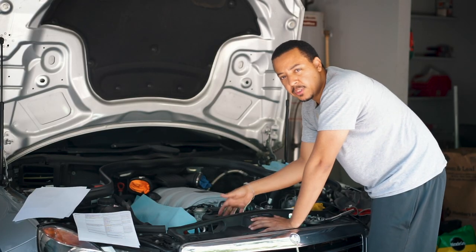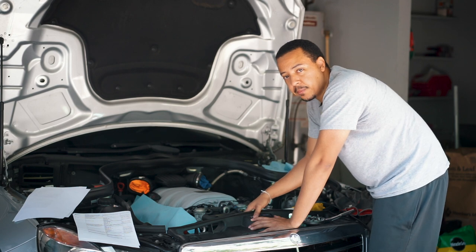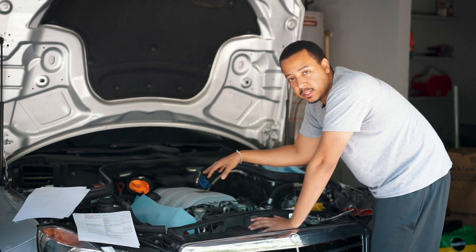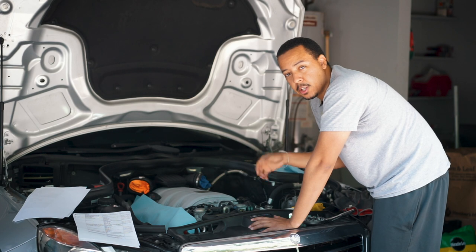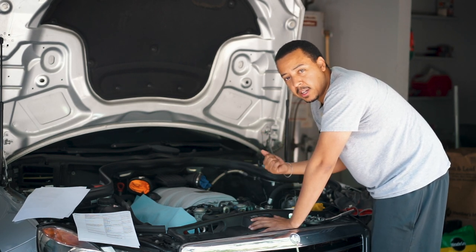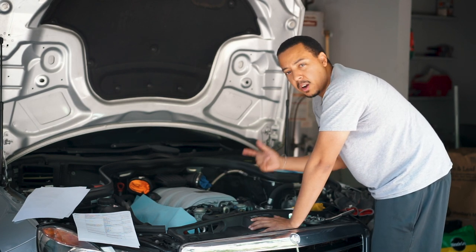All right, so if the crankshaft is too hard to turn, you may have a lot of compression on there, and one way to relieve that is to remove the spark plugs. Because right now I currently have the spark plugs still installed and it's kind of hard to turn. So I'm going to uninstall the spark plugs and then see if that alleviates some of that compression, and then I should be able to turn it a little bit easier. All right, so let's do that.